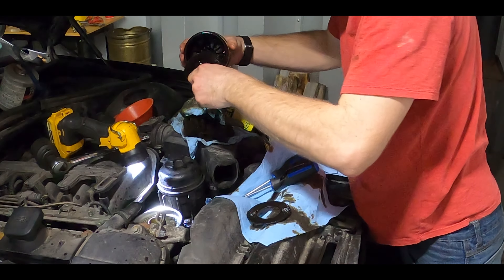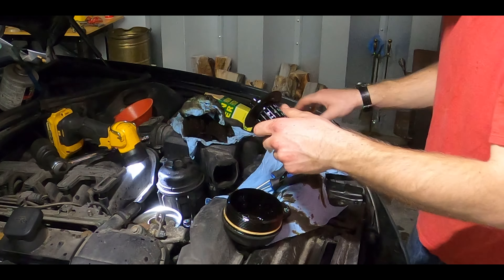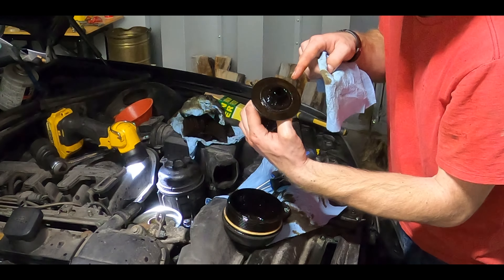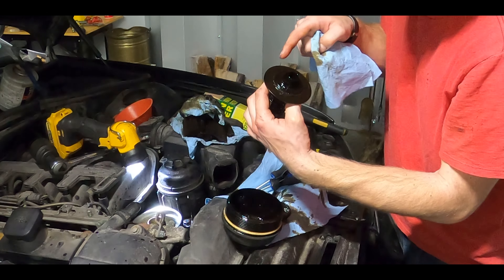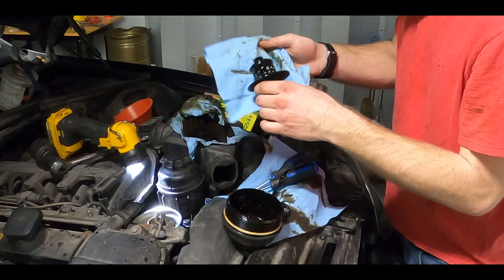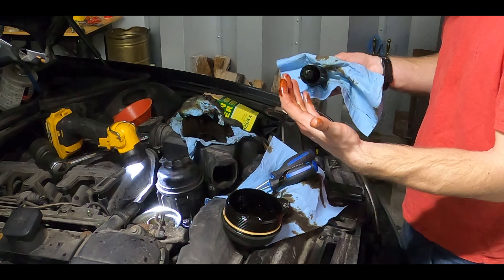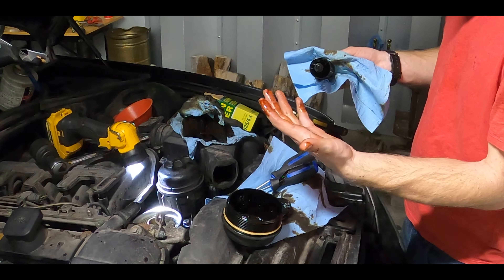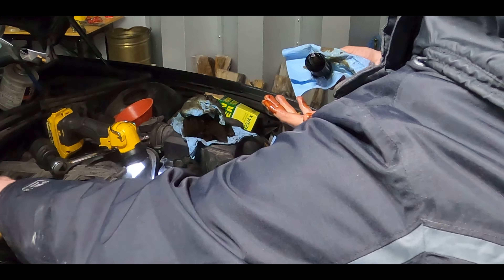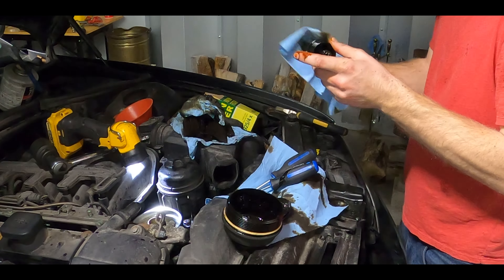Hope you can get that back in there now. There's your filter — Hengst, made in Germany. It wasn't even a Mann filter. Mann filter is the OEM filter for this car. I made sure I compared between German parts and Amazon. This oil color is very concerning. BMWs are known to have issues — just old, I guess. It's kind of milky. It's a 22-year-old BMW thing. Well Greg wants to get an E30 — he thinks maintaining this is gonna be troublesome.